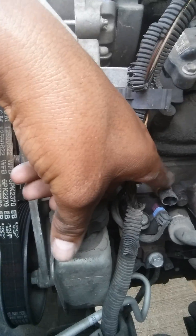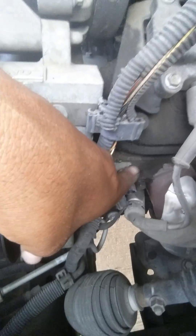It's located on the driver's side on the engine block head. I hope you can see this right here — I disconnected it right there. What you do is just use the 17mm, take it off. It screws off to the left. It has a little clip — this little clip comes off, so be careful when you take it off. Know that the clip comes off; it's separate from it.